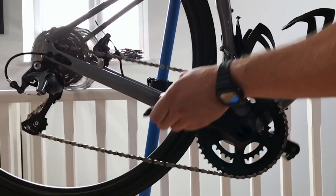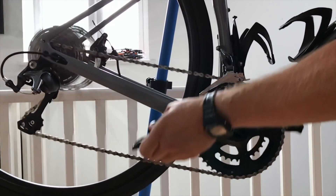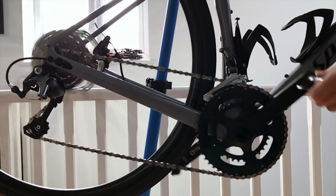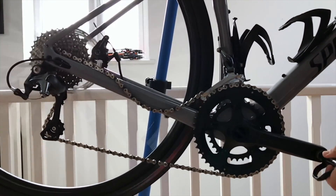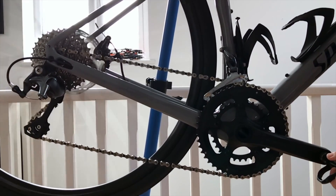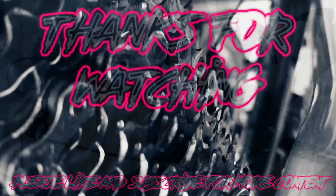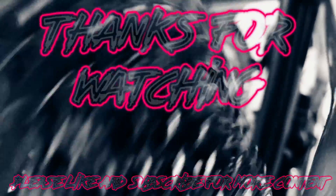There's a vast improvement when we consider the abrupt pedal stopping at speed in terms of chain control. It will limit the amount of damage the chain can do to the chainstay, and if you're running knobbly tires it will help prevent any chain suck that an out-of-control chain interacting with tire knobbles could cause.